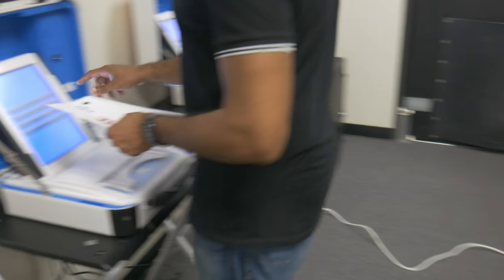We are going to cover common issues and how to troubleshoot them. Please understand that you may not attempt to troubleshoot a problem on a voting line with a voter present, as you may inadvertently disrupt that voter's voting process. If the headphones on the ATI are not working, check that they are plugged into the audio port with the headphone symbol. If an e-poll book is losing power throughout the day, verify that it is plugged into a lightning cable and that the lightning cable is plugged into a white charging brick — the USB ports on the surge protectors are not sufficient to keep the e-poll books charged.